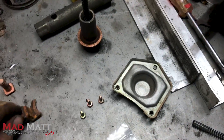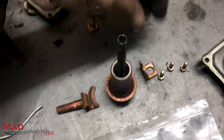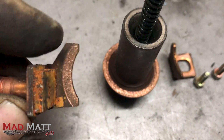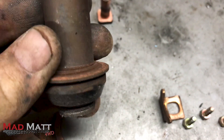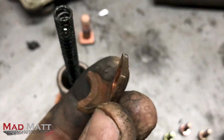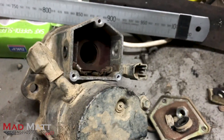This is where your actual problem comes in. Let me show you this old slug which was giving me grief. As you'd appreciate, electricity needs a good contact to travel through something. See the round circular wear point on the tip there? See how it's not flat — it's got a bit of a taper to it. Look at all the marks and pitting on that surface. Does that say to you you're going to have a good electrical contact? Not to me. These contacts and that slug are pretty well stuffed, and hence they came out of this old starter motor.